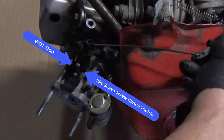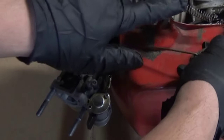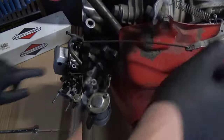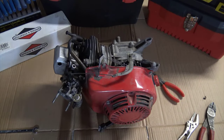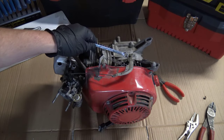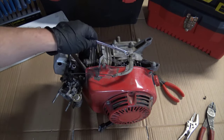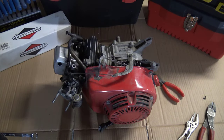So this is closed throttle, that's wide open throttle, and you can see that the governor spring, although it's been modified, it is pulling the throttle mechanism to wide open throttle. It's the job of the mechanics inside the mechanical governor system — the speed sensing element, flyweights, etc. — to pull the throttle closed to prevent the engine from overspeeding.